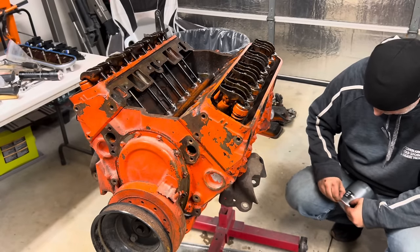Oh. I've done spun this motor over I don't know how many times. Yep. Now I'm gonna have to set it again. That's our zero mark right there. Looks like I had this 180 out this morning. Glad we redid that. 1-8-4-3-6-5-7-2. Sound right to you? Right. None of these plug wires matches. Well, like you said, for a test, it'll be fine.